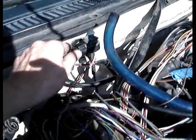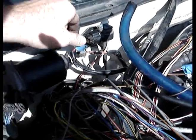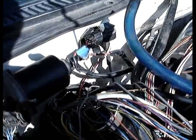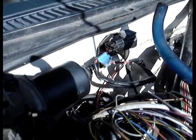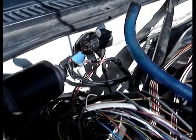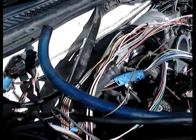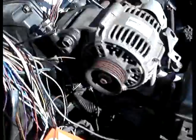The Autronic has its own internal air pressure MAP sensor for intake manifold pressure. This is the stock Celica MAP sensor, but it only rates to about 1.2 bar, which is really low. The Autronic has its own built-in one anyway — all I have to do is run a vacuum line from the intake manifold into the interior where the Autronic is going to be mounted. But that's it — that's all I really have to show you guys.